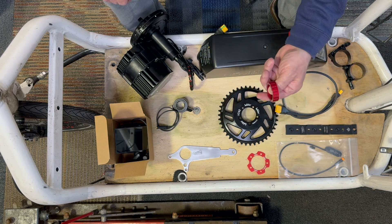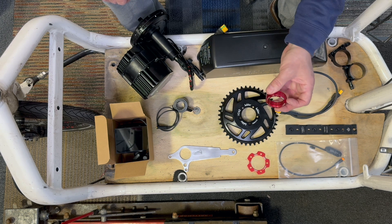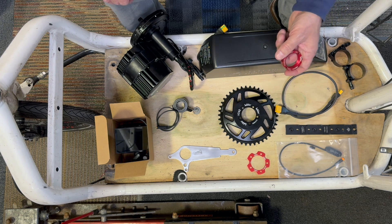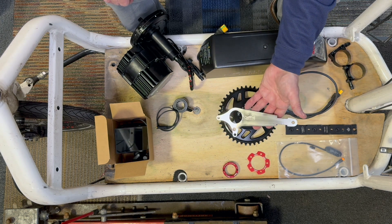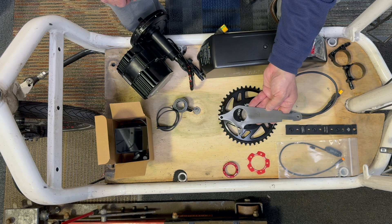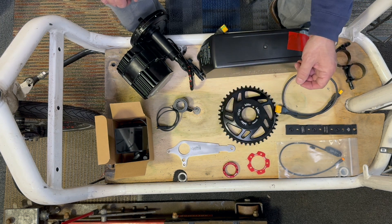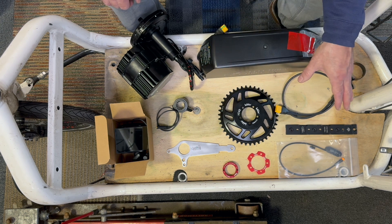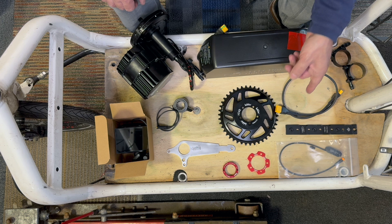This is called a one-nut. This replaces the two-nut system that you would normally use on a BBS motor install. The cool thing about it is you torque it on and then it's got a couple of lock nuts that lock this sucker in place, so you'll get a lot less likelihood that you'll have a motor that comes loose. And this torque arm is going to keep the motor from rotating and keep it in place where it's supposed to be. Those are both things that help it maintain its position on the frame. So those are some optional parts — with a BBS HD unit, you're probably looking at an extra $100 to $200 for all these things, but they make your system much more reliable and they also make it last longer.